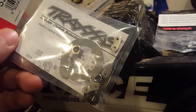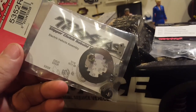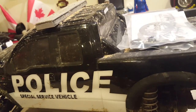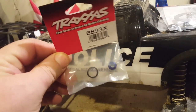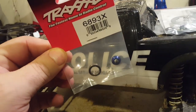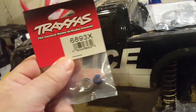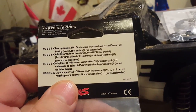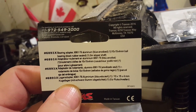Basically, these are the aluminum pressure plates instead of the standard ones that usually come with it. These plates are a little bit bigger — I'll show you the difference between the two. Another thing I got is part number 6893, which is a little bearing and a shim. The shim is usually plastic, but it's better to have it in metal. It's the bearing adapter in T6 aluminum.